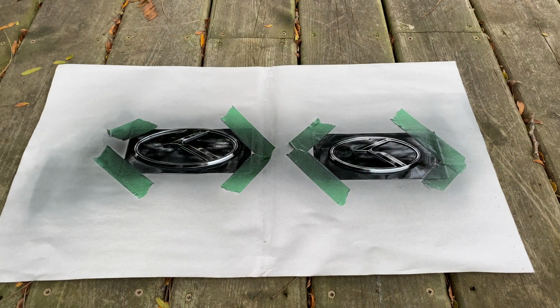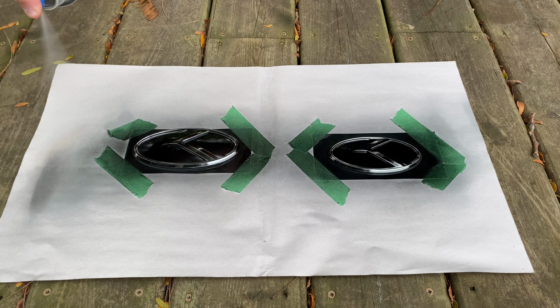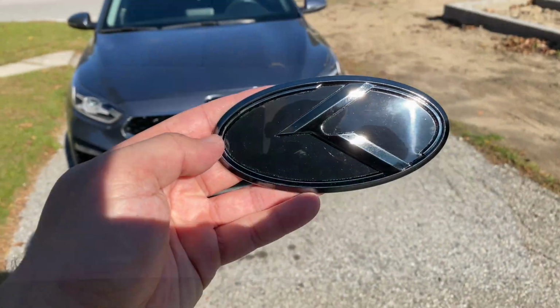This one is a 3 or 4 coat if you'd like, the last coat being a heavier coat. I did multiple strokes off camera. I just forgot to bring the camera out when I did that portion. After you do the final coat of the clear coat, make sure to let it sit. It calls for 4 hours for it to fully harden.